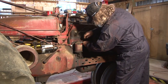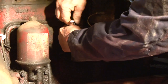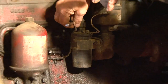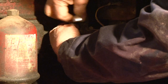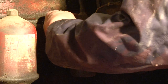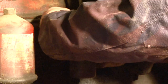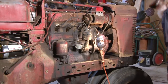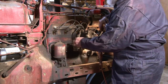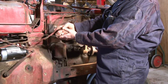This is a 6-volt coil. You can switch the wires — we have to convert this over from a positive ground to a negative ground. What we're going to do is actually take this coil off and put an internally resisted coil on this thing. Just lift the old coil out. I've already started — the wires for the coil, I've already got them off back to here, and I'm taking the wires off.